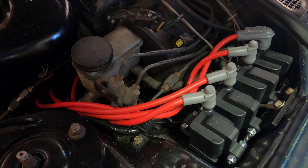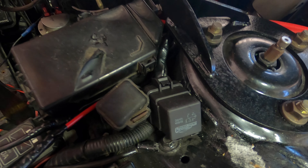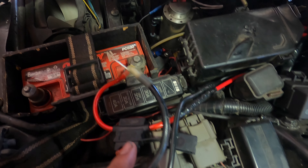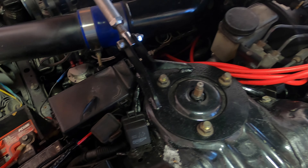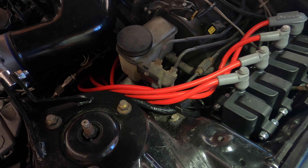Overall, I think I'm pretty impressed. I think I'm going to get ready to fire it up — all the wiring is done. Here's the relay for the igniter, a separate fuse directly to the battery, and the other terminal for the negative. So I just got to wire in the negative, power it on, reconfigure the Power FC for the new coils, and fire it up.